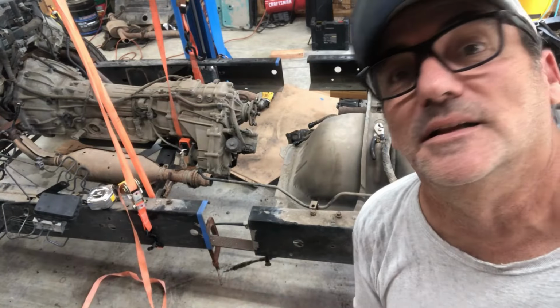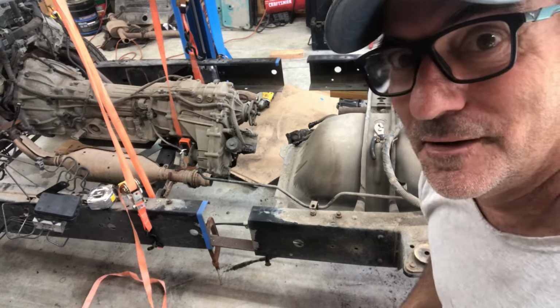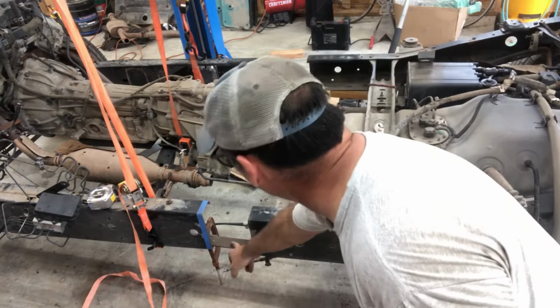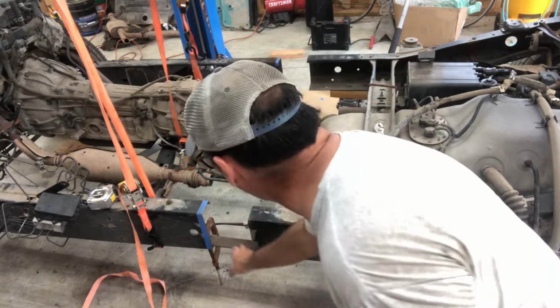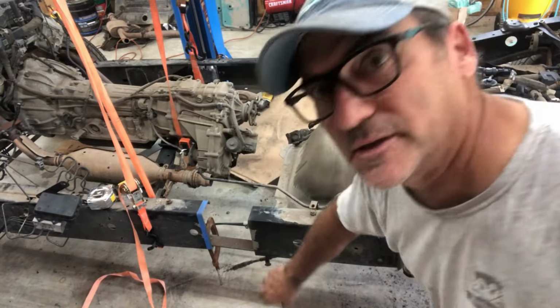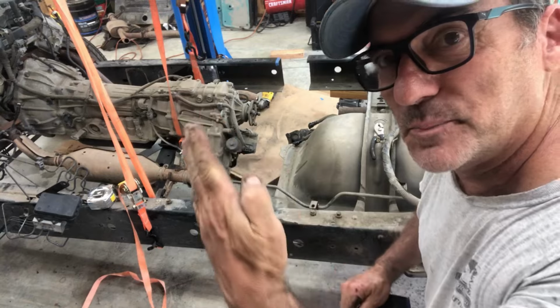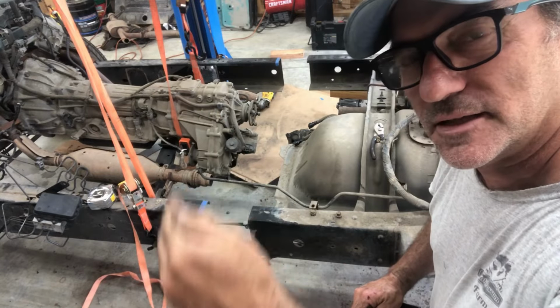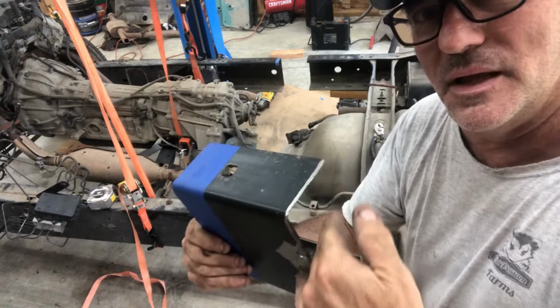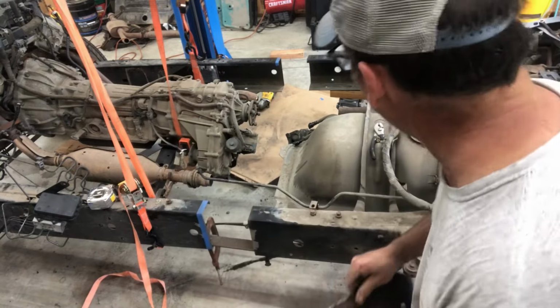She is cut. Eat your heart out, Ian Roussel. I did it. 6 inches. I put me a little file in there and clamped it. It still dropped. You seen it? Boom. But that's okay. I made sure at the end I didn't have my blade jammed up in there all the way. I just ran the very edge of that blade on. That way when it did drop, it didn't pinch my blade and throw stuff everywhere.